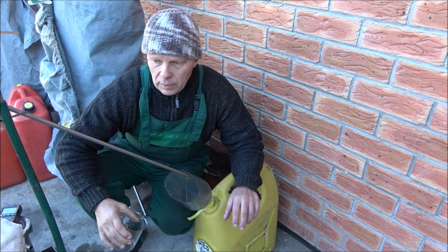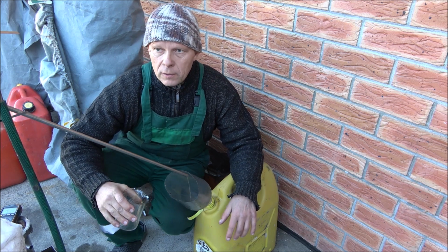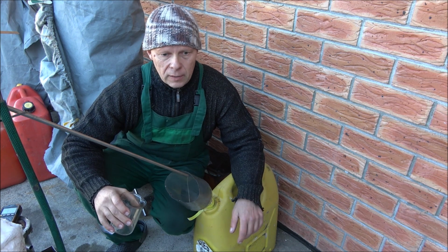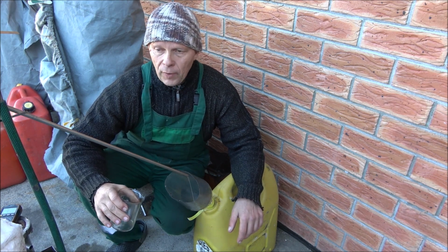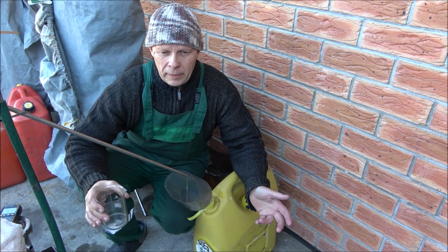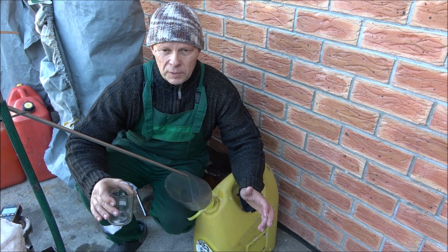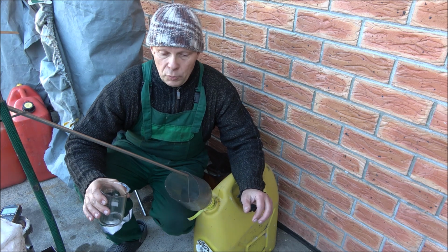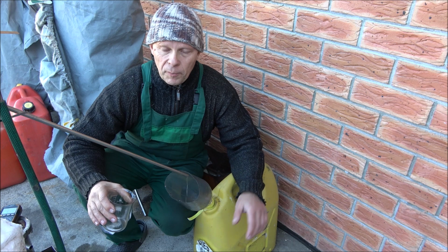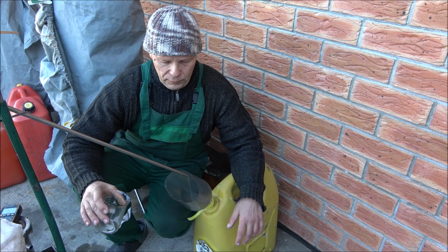Now I tried to clean contaminated diesel fuel with all sorts of chemicals, centrifuge, and it's still dark. It's still dark because some carbon is so fine and some resins and asphalt or whatever in used motor oil are actually contaminating the fuel, and it's almost impossible to get rid of them. I could use the sulfuric acid method, but I would like to avoid this type of method because I personally don't like to do anything with sulfuric acid.